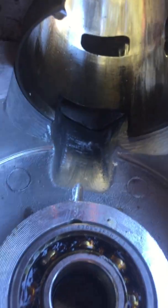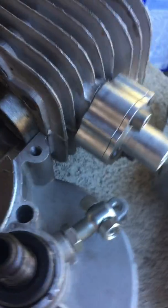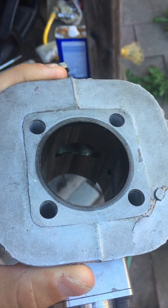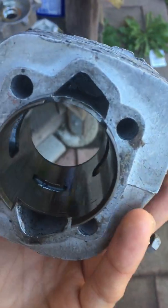If you look close in here, I kind of took off too much material on the right side, but that's okay — it's still night and day, so much better than stock. The high-performance bearings will make a big difference, and the porting will make a big difference. Those are the two main improvements, besides the balanced crank. The cylinder I'm using is sleeved — stock bore 66cc, uses the 47mm piston. Nice big exhaust port and excellent transfer ports on this jug, also made by Barbara Racing.